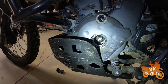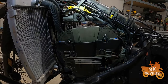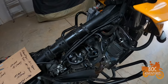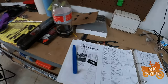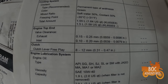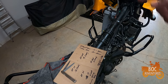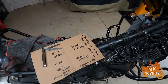Like I said, this ain't a how-to video — Tim Two Wheels' video is very, very good, highly recommend it if you're gonna do this yourself. So there are the valves. The exhaust and intake specs: 0.15 to 0.25 mm for the exhaust and 0.10 to 0.20 mm for the intake. On the exhaust side — which is the front — the left one is at 0.15 and the right one is at 0.13, so the right one is out of spec. The left one is just at the very bottom of spec, so I'm probably going to order shims for both of those.